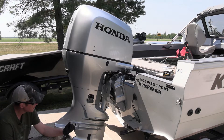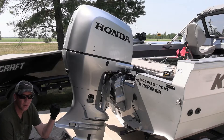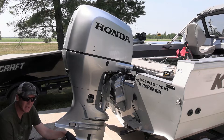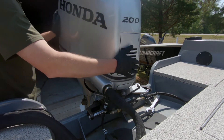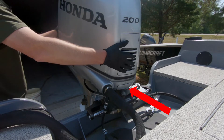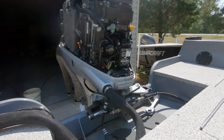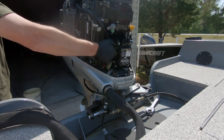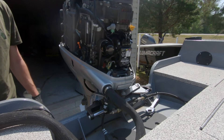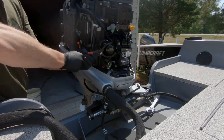Through the miracle of time, all the oil has basically stopped dripping out of the drain plug — just a very small drip now. Next you're going to want to take off your motor cover and then remove the oil filter. There's a little trick to not having such a mess. Pull the release, the motor cover will pop up a little bit — lift it straight up and move it to the side. Your oil filter will be located right here. Sometimes you can get it off by hand, but this time you're going to need a filter wrench — just break that seal until it's finger tight.